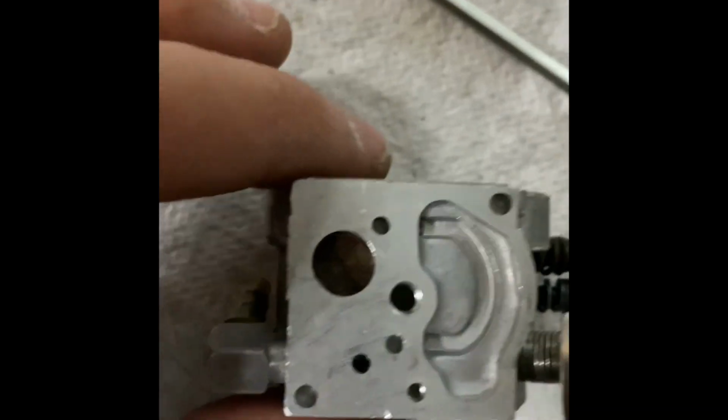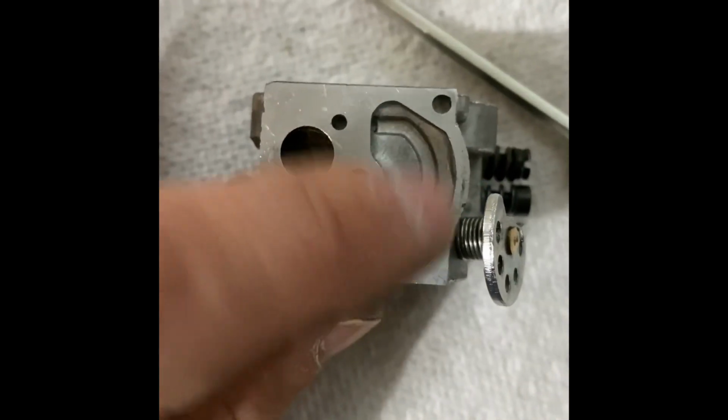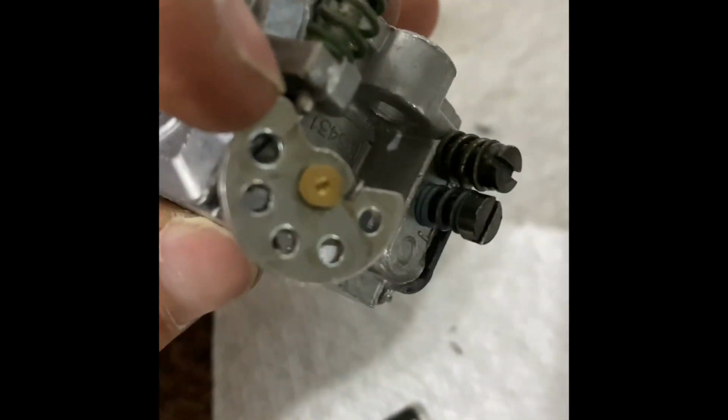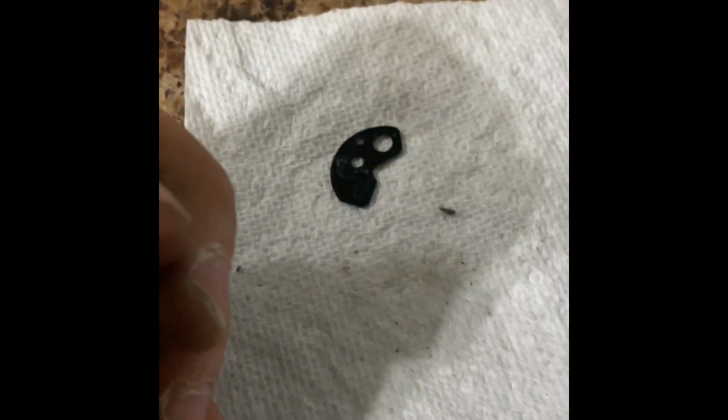I think all we have left is this last plate. So let's find that. I hate that I couldn't use that new screen. That makes me so angry. That's fine. I brake cleaned the crap out of those, or carb choke cleaned the crap out of it. Let's get the gasket. And it's on. All right, we've got our idle adjuster, which adjusts what we idle at. We've got our screws. Got this plate, got this plate. Got your fuel in. Got your little butterfly valve boy. And I believe that's it.